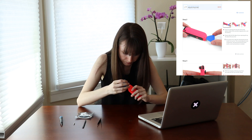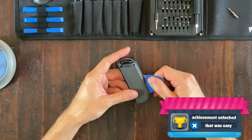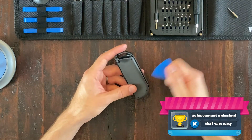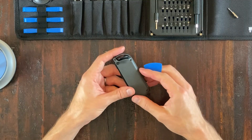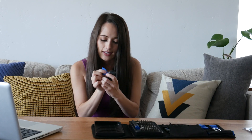The next step is to get an opening pick and push it into the seam at the bottom edge of the controller. Whenever you do this, you want to make sure you don't insert the pick any farther than you need to to get it apart. That didn't take much. If you jam the pick all the way inside, you can potentially damage internal components, so don't do that. And the guide tells me it should open like a book — and it does.